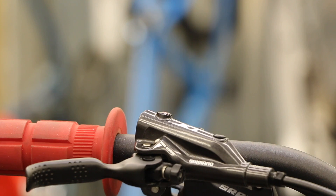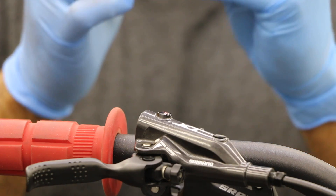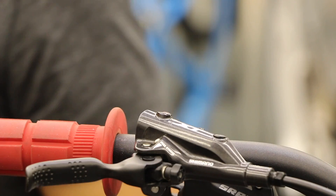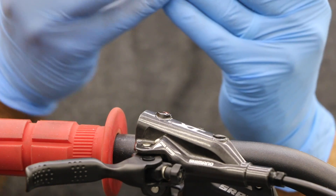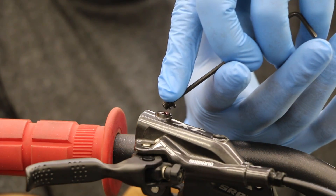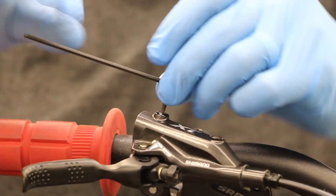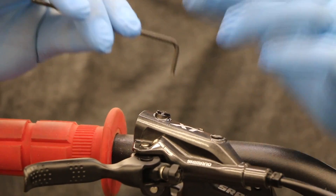We're going to have a little bit of spillage. When you go to put your bleed screw back on, my little O-ring fell off so I'm putting that back onto the screw. Be really conscious of where this is — it's going to help form a seal. You can put the bolt on with your tool; I'm going to use the longer end, put the screw on it, hold it with my finger, and come in upside down. We've got some spillage, which is totally fine — this is actually what we want, making sure we're pushing all air out. Get that snug.